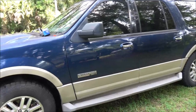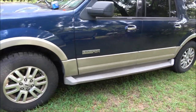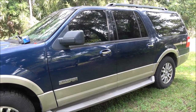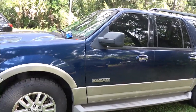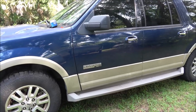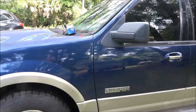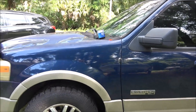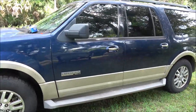Couldn't get it to do anything, couldn't get it to read any codes. So we took it for a drive — nothing, no codes. Finally, when he was backing into his driveway, it started chugging. I ran the codes real quick and I did get a code: P0022, which is Bank Number Two cam sensor. So we're going to put that in.